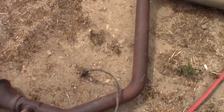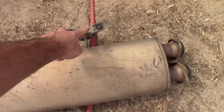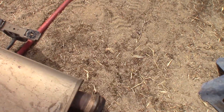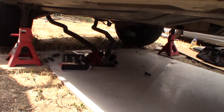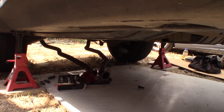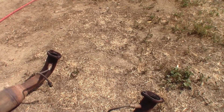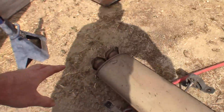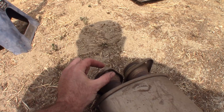You can unplug them. We've removed these two hanger brackets and then these two hanger brackets as well. We also unbolted the exhaust in the back but left it in place. You can see it down there. We unbolted the hanger so we had a little bit of room to move it back. That way we had some room to drop these down out of the engine.